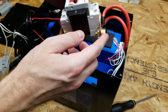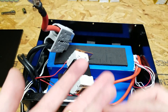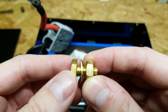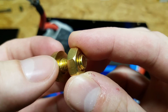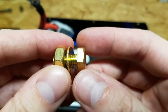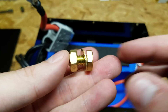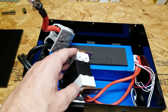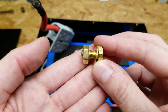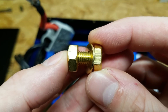We're going to disconnect the positive leads — that's a 14mm socket to get those bolts off. I will say they were not tight at all, so maybe it was just a case of these bolts not getting tightened down enough. As you can see there's only one flat washer and no lock washers. When I removed this bolt I didn't even have to use a wrench on the other end — I just twisted loosely with the ratchet on one side and it popped right off. This bolt should definitely have a lock washer on it, especially considering this metal is going to be constantly heating and cooling throughout the life of this battery.